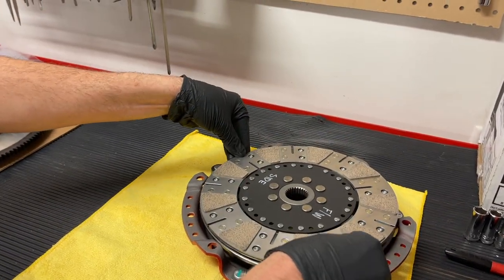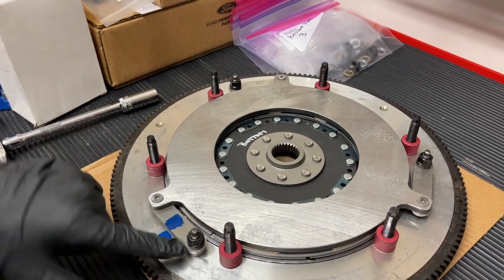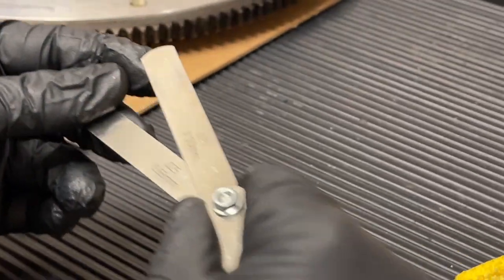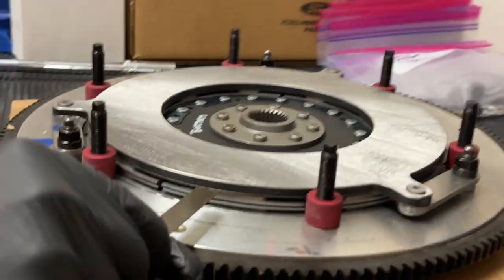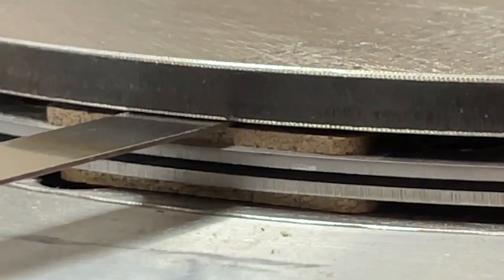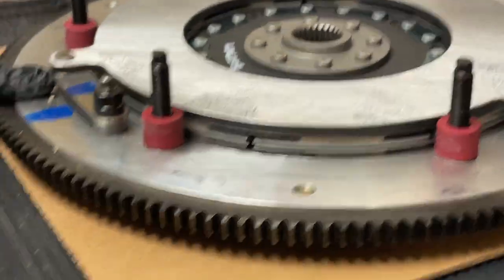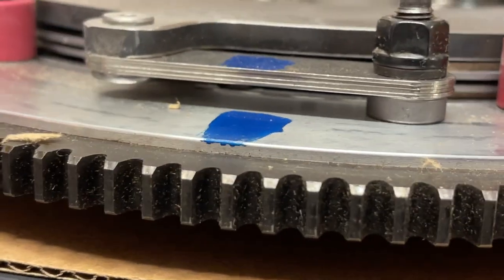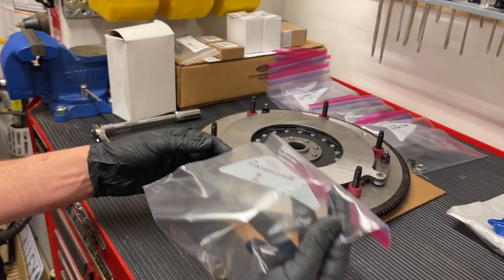We're basically going to unstack this. Next we have the floater plate, which acts like another pressure plate, with its nuts and lock washers. When it's on the car we take our 20-thousandths feeler gauge and make sure it can fit between the disc; if you have more than 25 thousandths you're going to have to rearrange it with different shims and washers. Notice the paint mark, and notice how the strap is on the bottom, the flywheel side of the floating disc — don't put it on upside down when reassembling.